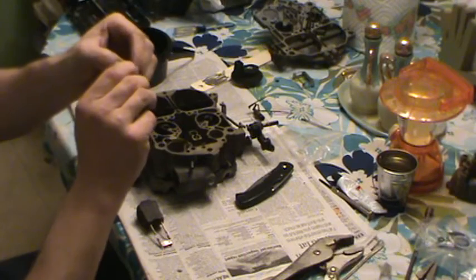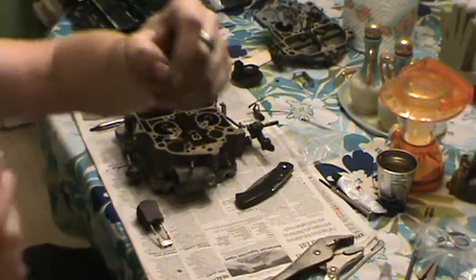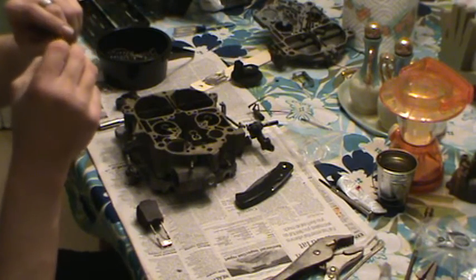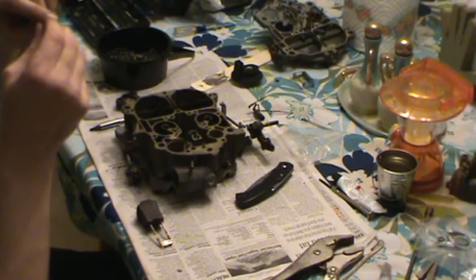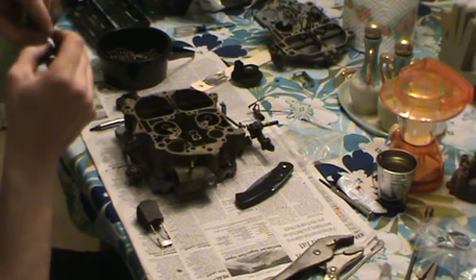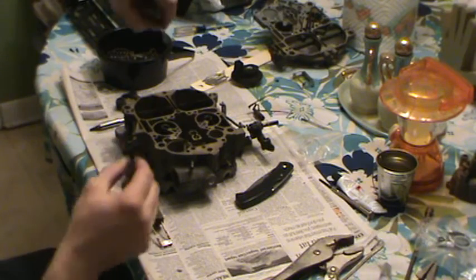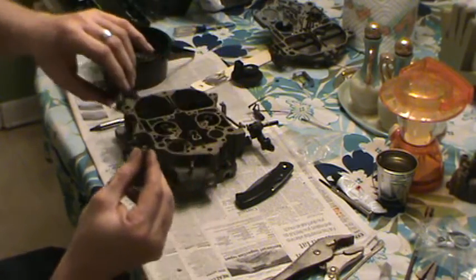This is tiny. I can't hardly even show it to you. That's how small it is. It's just a little piece of wire, and it's got a looped end right here. The looped end goes around that top part, the opposite from the rubber on the needle valve. Slips around it like that, and just kind of stays on there. And then you run it back through.